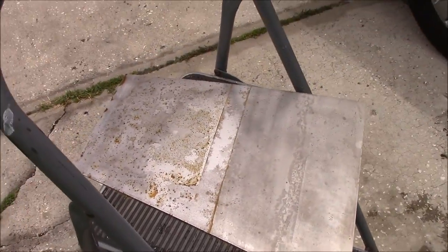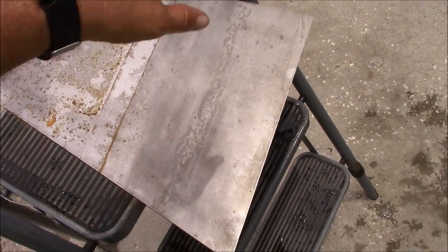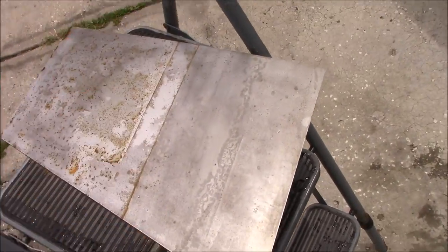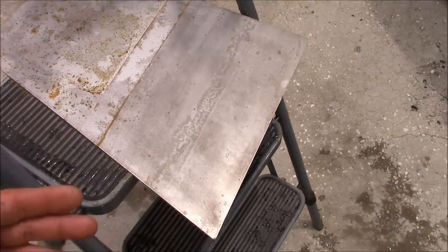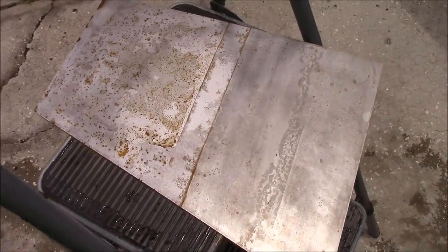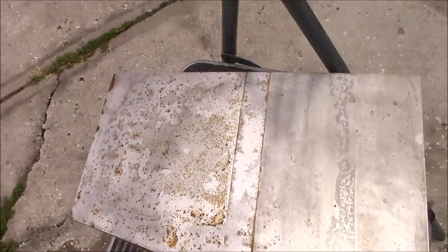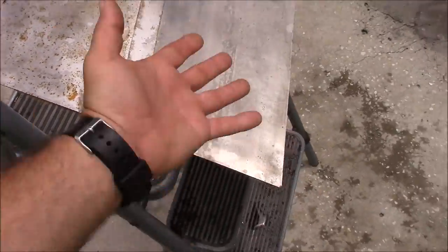So, boom, baby. That'll be part of the force field protection system. It's not complicated to apply, as you saw. I literally just sprayed it on. What I generally would recommend is more of an even coat after you clean your undercarriage really well. But this is not a product where you just spray it on, let it be. You're going to have to get in the nooks and crannies. You're going to have to apply it, so it's going to take a little bit of time. I would say about an hour and a half-ish for a full undercarriage. Hit the frame, hit everything you don't want to rust, and it will do its best to not rust.